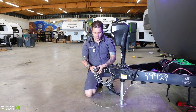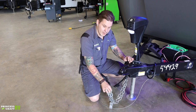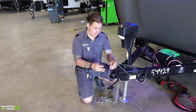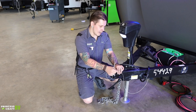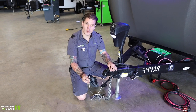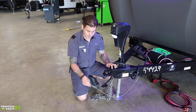Next up, we're going to take our tow chains. These are going to be crossed underneath the coupler and hooked onto the receiver of the tow vehicle. It's very important that we skate that fine line of having enough room to make our turns left to right, but not so much room that they may make contact with the pavement. Riding right next to those tow chains is your emergency breakaway cable. If the tow components were to fail, as the two vehicles separate, this pulls on a ripcord, essentially putting full 12 volts to the electric brake system — keeping you from encountering a runaway camper scenario. You need a third connection point on the receiver for this cable, whether a carabiner or quick link, and make sure you take the slack out so it does not make contact with the pavement.